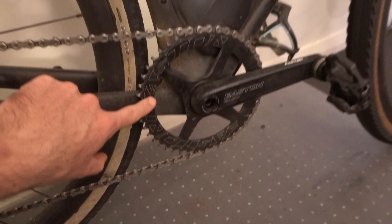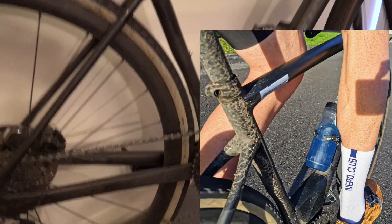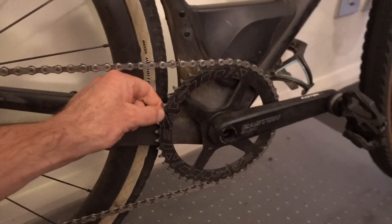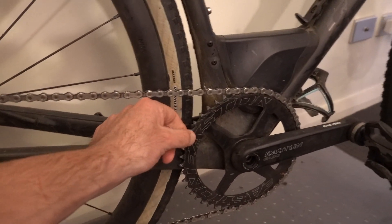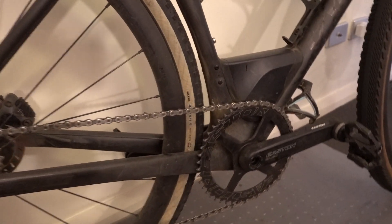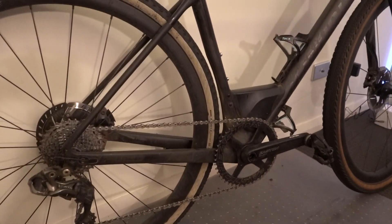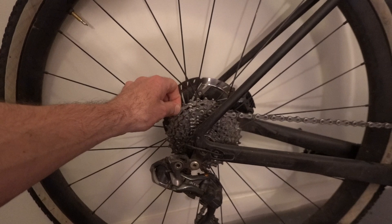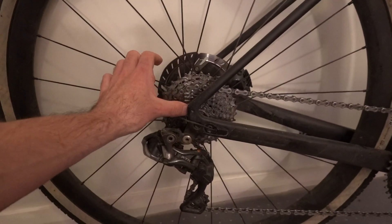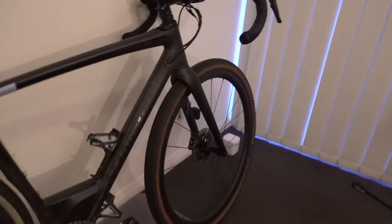I have changed the chain ring that came on it. This thing is absolutely filthy and I'll explain why later on — please excuse the absolutely disgusting bike. But this is a 46 tooth chain ring, which means I can train on the flat around something like Centennial Park and not spin out. I've got a standard road cassette on here — this is an 11-32 Shimano cassette. It came with a massive like 44 tooth or something, so I swapped that out to a regular road cassette and the rest is pretty standard.